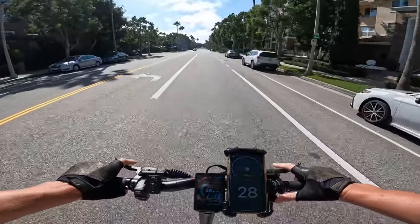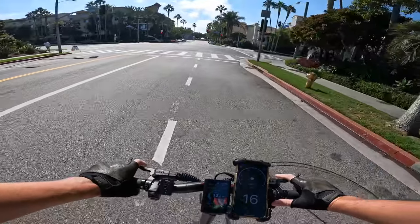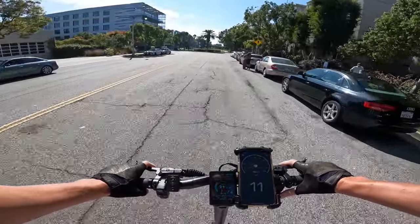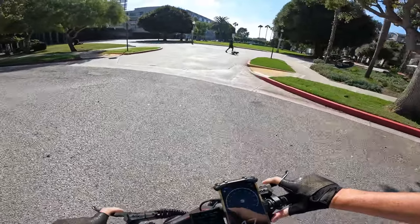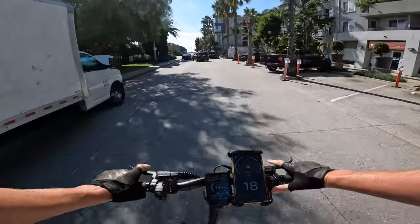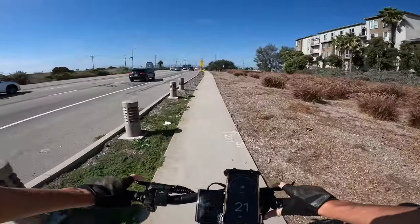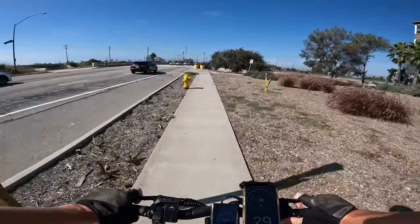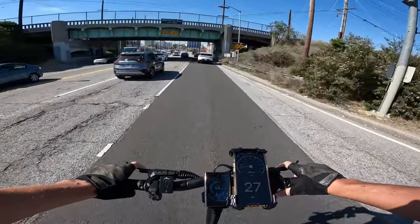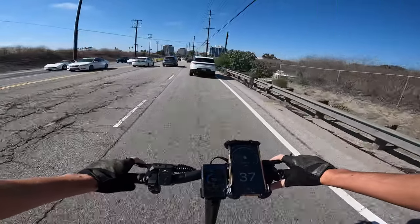The display shows red under full throttle and yellow at medium power. There's definitely a regen brake but it lags about a second from when you touch the lever and it's pretty strong. Bumping to mode 4 — this thing has the juice. There's no noticeable throttle delay. Merging into traffic on mode 4, full throttle, slightly downhill — we're holding 36 to 37 mph, keeping up with traffic.